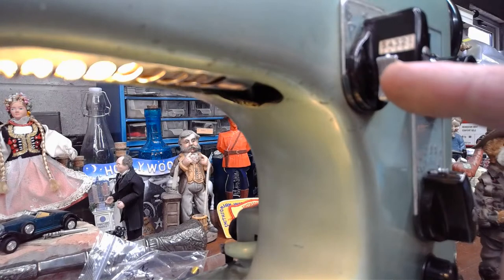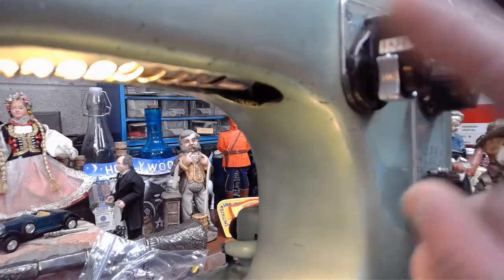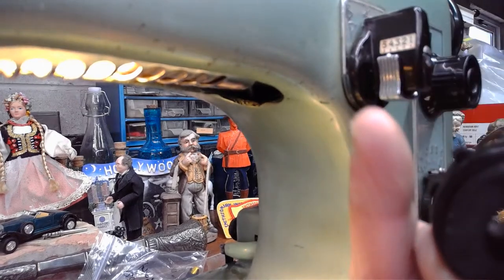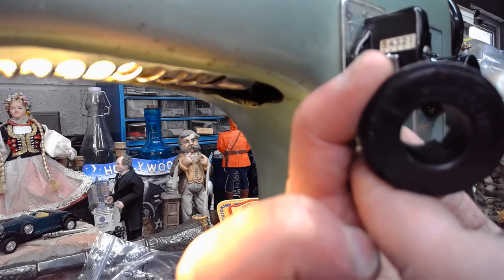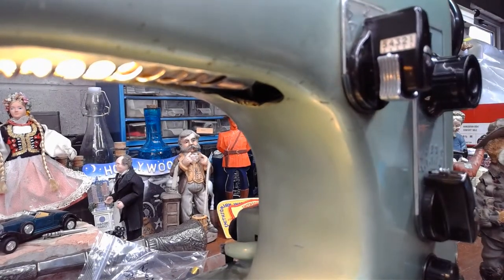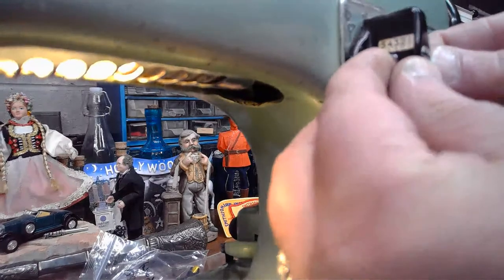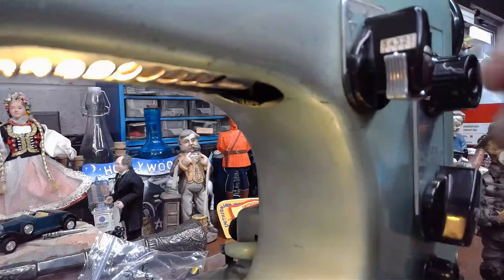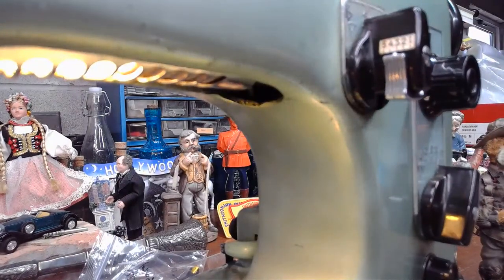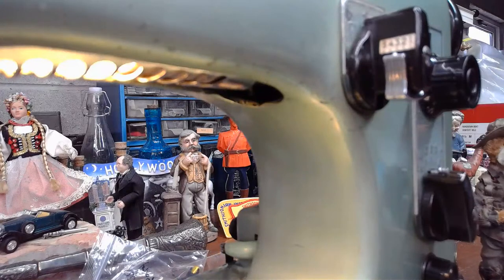And then let's say we just sewed pattern number 4. Before we try moving this slider again, because right now that finger is pressed into the cam, we want that finger to retract before we try moving this slider. So we take our stitch width down to 0 to retract that little finger that reads these cams. And then we should be able to move this into position 3, which is what I just did. My glasses are so dirty. I think we're in position 3. Yeah, we are. And then we have to remember to move our stitch width back to 4 or somewhere in that range again so that when we start sewing, we don't get a straight stitch that's very, very tiny. And that's happened to me before.